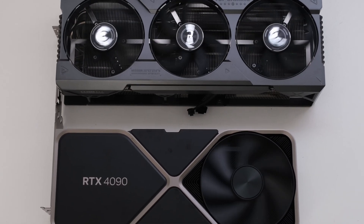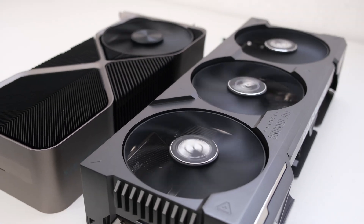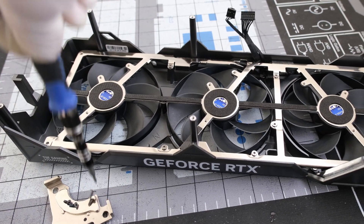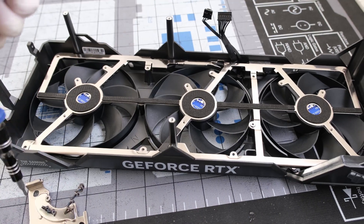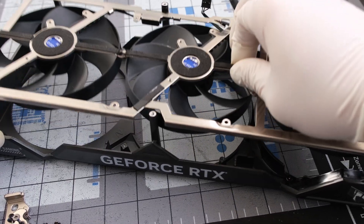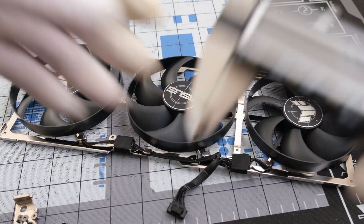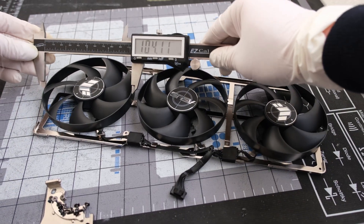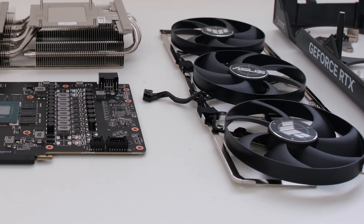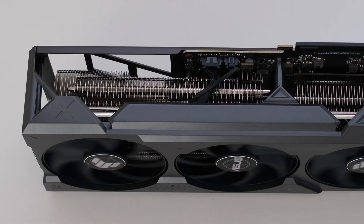Here is a comparison of the cooler between the NVIDIA RTX 4090 Founders Edition and the ASUS TUF GeForce RTX 4080. Click on the link in the top right-hand corner for our RTX 4090 Founders Edition unboxing, thermal testing, and teardown with the full cooler disassembly. Let's further tear down the card to identify and measure the fans. There are nine screws to remove on the metal fan brace and one additional screw hiding underneath the anti-vibration tape. With those removed, we can detach the shroud which houses the RGB LED module. The fans are now accessible and measure approximately 104 millimeters in diameter. There are four remaining screws to detach one of the fans — they are 12 volt 0.55 amp champion brushless DC fans. Stay tuned for upcoming episodes as the plan is to install a water block on this ASUS TUF GeForce RTX 4080 and then install it into a water cooled PC build.